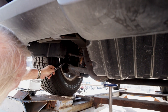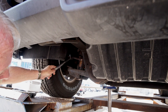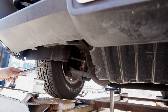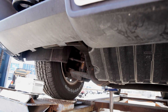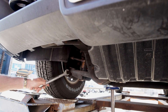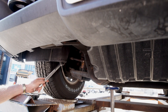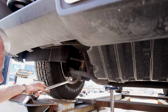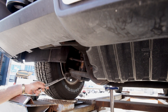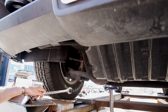You're not going to eyeball your camber in, and you're not going to worry about your caster right now — you're going to eyeball your toe in. What we need to do is just break the jam nut, back it off a little bit, and we're going to take our wrench and adjust the toe. We're just going to eyeball this in and look down the tire and get it as close as we can. You might want to break this jam nut loose while you're doing the installation to save a little bit of time — when the truck's brand new that nut's pretty tight.